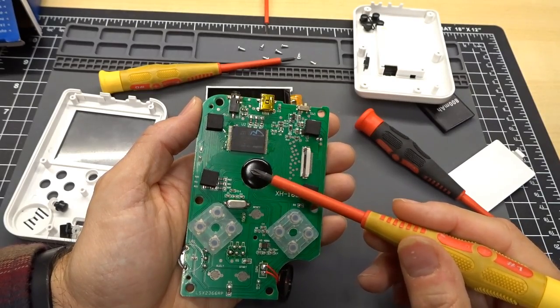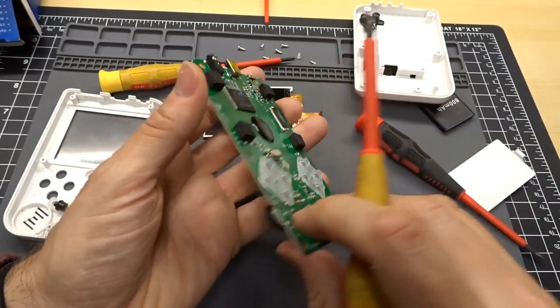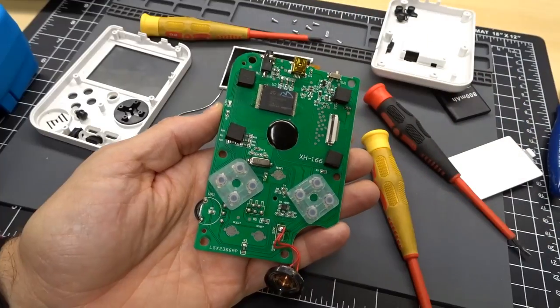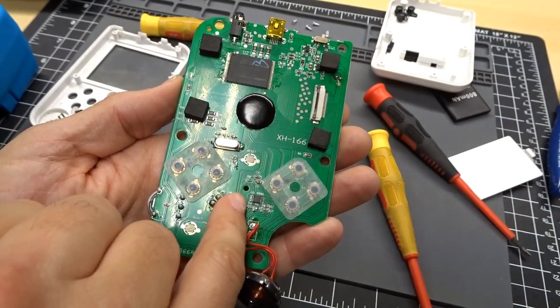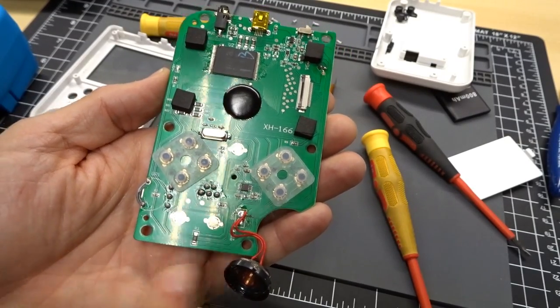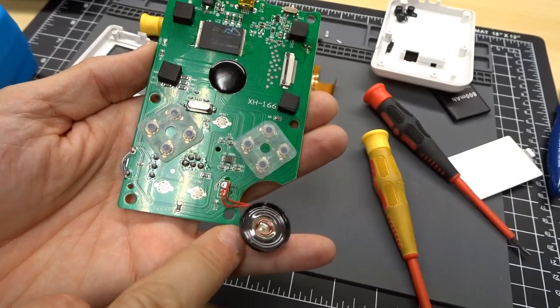And maybe there are actually two dies under here. It's really hard to know. It's not like there's any kind of bypassing going on the back. All right, so in here we have this IC right there, which is an LM4890. That's an audio amplifier chip. Obviously, that's what drives the speaker.